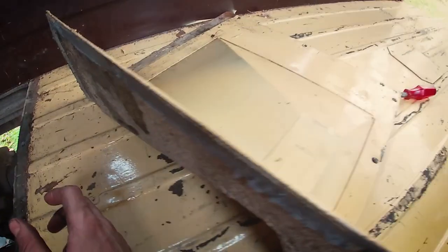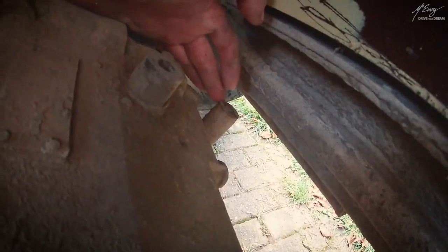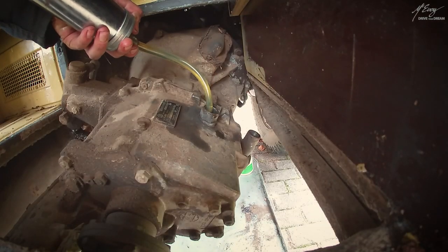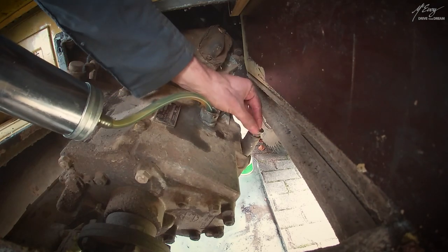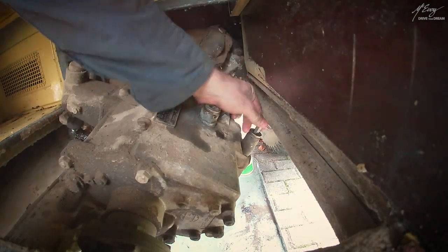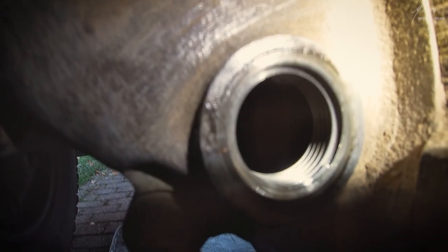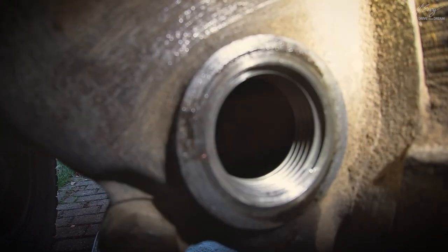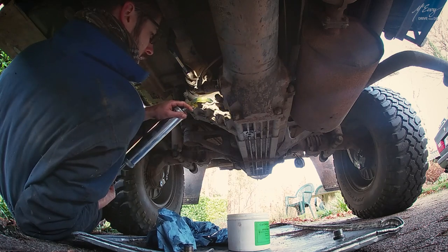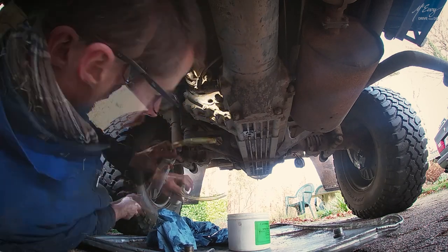The diffs are very well thought out: we have the filler plug located at the top of the differential and the oil level control plug in the lower location. You fill from the top until the gearbox oil flows out from the oil level control — and that's pretty much it. Filling the gearbox is a bit like filling the diffs: just fill the oil until you see the level at the oil level control. For the transfer box it's slightly different — there's none of those fitments, you just have to fill it until it dribbles.